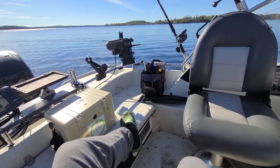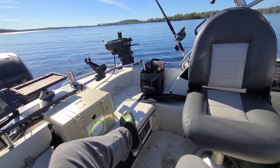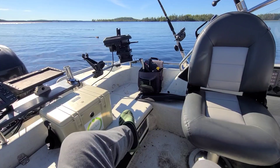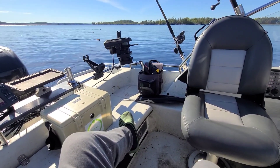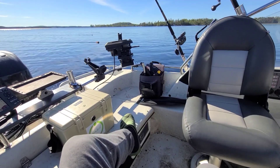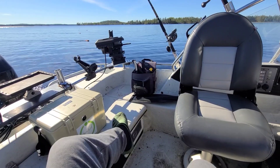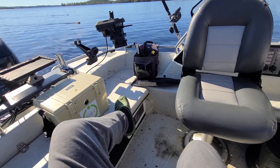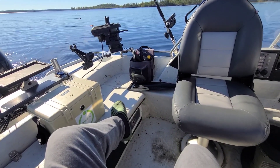So, the current is within the normal range, you can hear the pump, and it doesn't heat up, so there is no short circuit. You also saw that I tested it for the ability to overcome the holding force with a simple plastic holder. It became clear that the problem is not the motor.